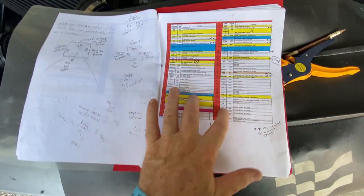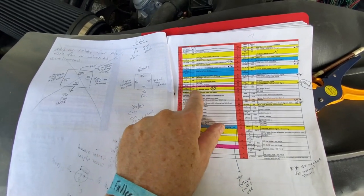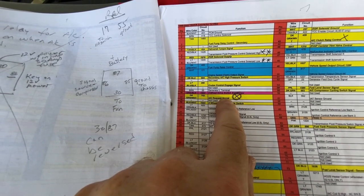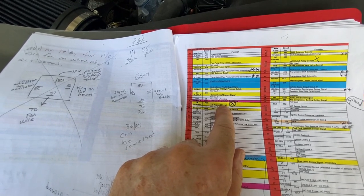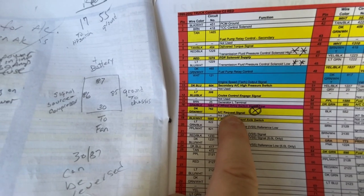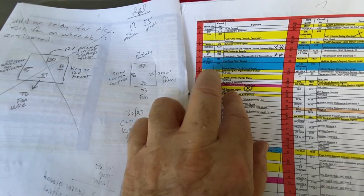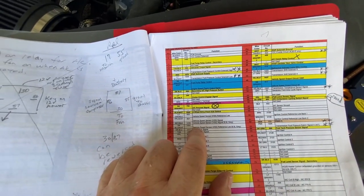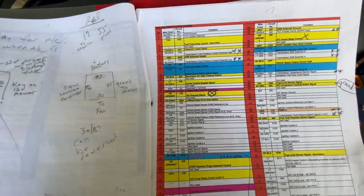When I was going through the red side — the red pin of the PCM — the two wires I found that worked: number 17, which is normally your AC request signal. This is normally a wire that he has marked in yellow that you would remove. So you definitely want to go through the wiring diagram and decide first of all if you're going to use air conditioning or if you're going to reuse fans or anything like that — you may need to keep the wiring and not automatically pull everything that is in yellow.